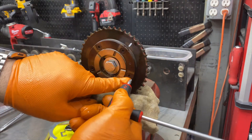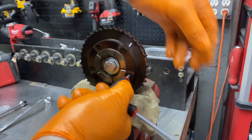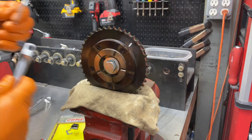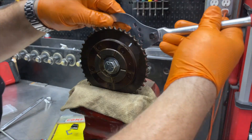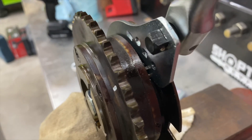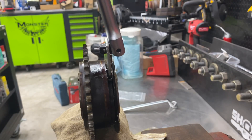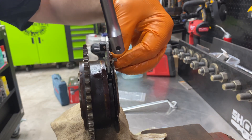First, this is our pin bolt — the pivot bolt — with the pin going all the way through. We're going to loosen this one half a turn so it becomes our pivot point. Then we'll take our 3/8 ratchet or pull bar, put it on there — this little notch hooks to the spring. You can see it's hooked to the spring and I can pull that spring away from the pin bolt. As I do that, I'm going to slide this little temporary lock in.